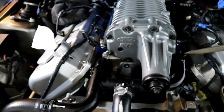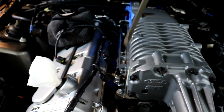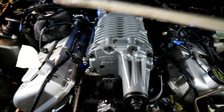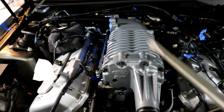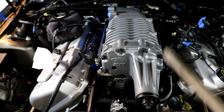So now what I'm gonna do is I'm just gonna take off the supercharger bolts, like right there. I think there's 5 on each side, just like the lower intake, and that can just pull the supercharger up with the intercooler. That will be still attached. But I'm still gonna pull up the lower intake manifold to get to the injectors and just to clean everything up.